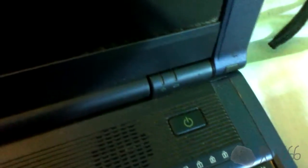The other oddity is in the indicator lights. You can see we've got the hard drive indicator and our keyboard lock indicators. There's no light on the power button. There's the power light. But the interesting one is the battery indicator. It is off when the battery is fully charged. It is blinking orange when the battery is charging. And it stays solidly lit when the battery is discharging, when it's running on battery. Seems kind of opposite of what you would normally expect. Maybe it's because the battery is a little bit past the point where I would call it bad, but I'd like to know why it does that. Maybe it's not normal, I don't know.